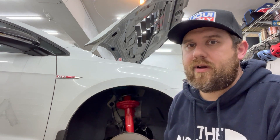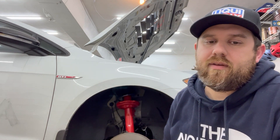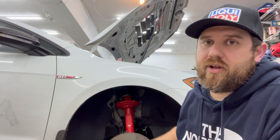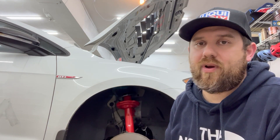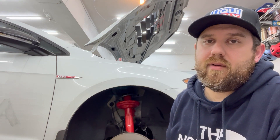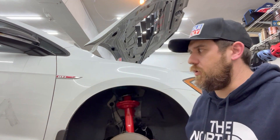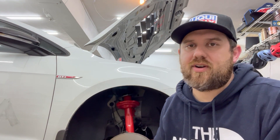That's something I've learned after spending lots and lots of money on other platforms. This car is pretty much all the lessons I've gone through learning, looking at everything, and questioning everything. The other topic I wanted to cover is the camber curve. I went ahead and measured the camber curve with the stock ball joints and with the 034 roll center correcting ball joints, all the way from full bump to full droop, so we can see exactly how much camber you gain throughout the amount of travel.